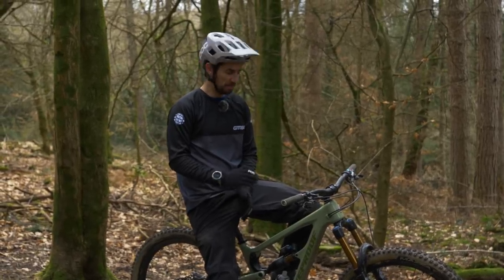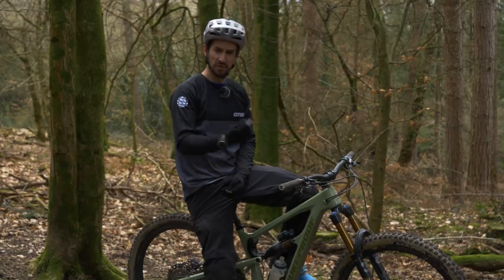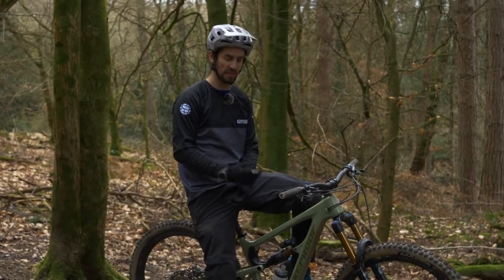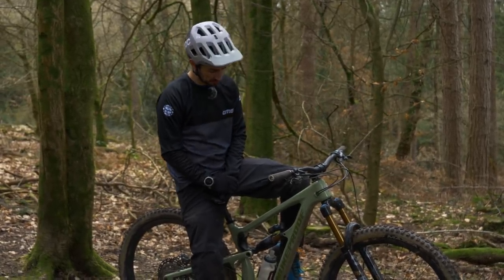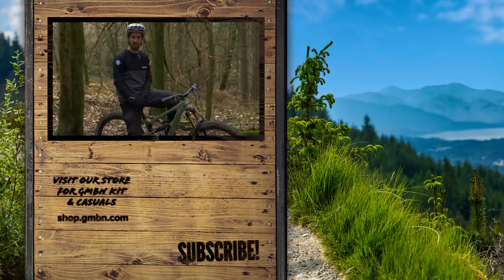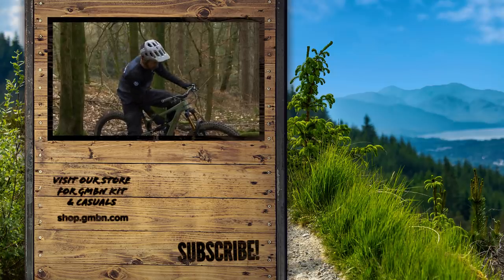In reality, you're never going to get your bike set up perfect for every track or every ride, but you can get it pretty close — especially if you start experimenting with your dials and really trying to work out how they affect your bike. I used to do testing with Fox back when I was a pro downhill racer, going to places and changing tiny little things on our suspension. If you actually ride thinking about it, you can notice the difference. I get the base setting from the website and I don't stray too far from there, although if I'm going to a bike park where it's pretty smooth with some big jumps, I'll use my lockout to firm the suspension up and get some extra pop. When I come to more natural places like this, I'll definitely open it back up for that small bump sensitivity.